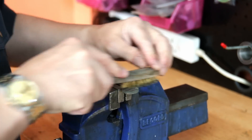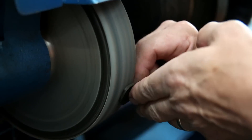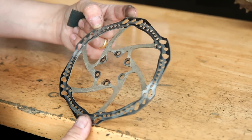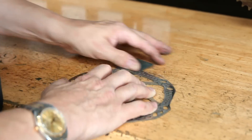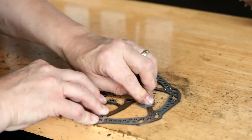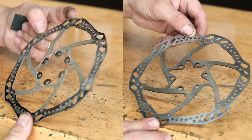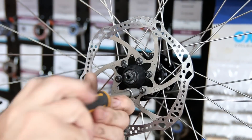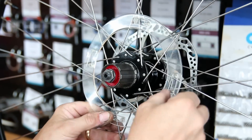Now these brake pads — the brakes were working so inefficiently when the bike arrived. Cable-actuated disc brakes are often very hard to get to the bite point nicely. We clean all those up. You can see on this disc the way it's scored around the edges and how the center's dirty, so I rub it down with emery cloth just to smooth that off — it stops that record player effect of a brake squealing. We go right the way around the edge and a little bit of wire wool on the center to clean it up. You can see the difference: the one on the left as it came off the bike, the one on the right as we're refitting it. I do the bolts up in a cross pattern — left, right, up, down — rather than going clockwise or anticlockwise.